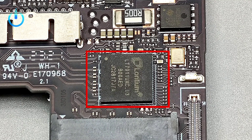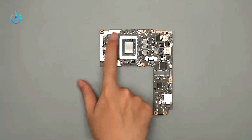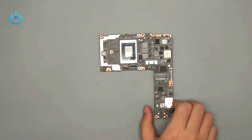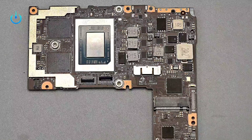Two USB-C ports are available on the mainboard, both running at USB4 speeds, using the PS8383 chip for full bandwidth realization. PD power delivery is provided by the TPS65993DF. The HPB charging scheme is controlled by the BQ24780S. There are also two small volume control buttons on the right side of the USB port. There is also a micro SD card slot that supports speeds up to UHS-II.